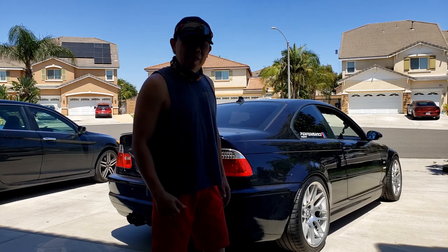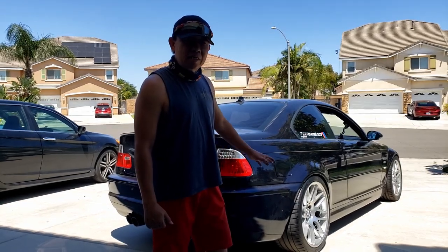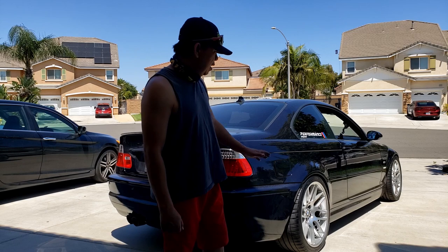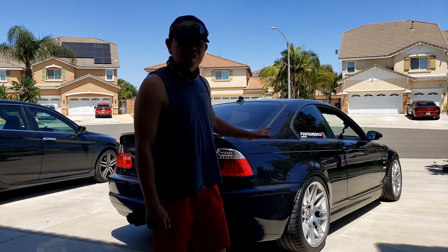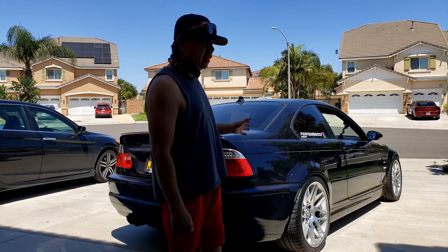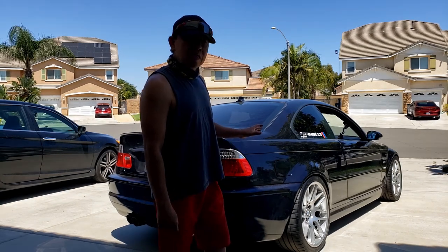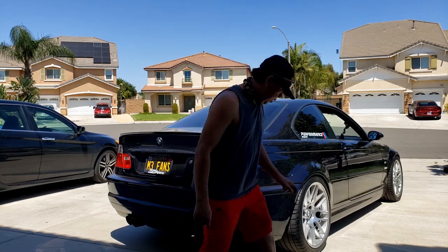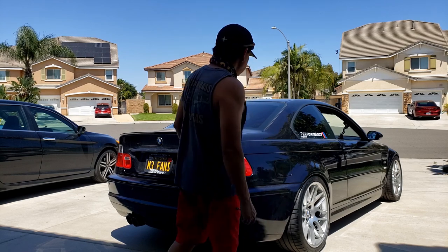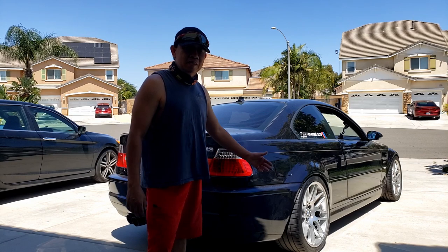But you guys comment below. I will do a walk around, to see whether the suspension is at the correct height or not, and whether it's going to rub or anything like that. I did a lot of measurement as well, to make sure everything is even on both sides. In this case, the front is a little higher, half an inch higher. The rear is exactly 23 inches from the base of the wheel to the fender on both sides, and the front is 23 and a half.